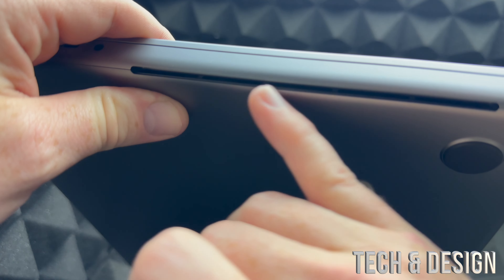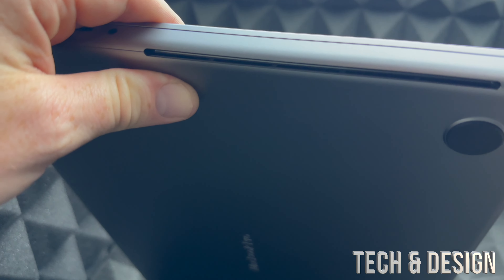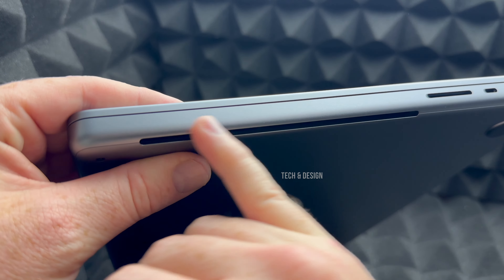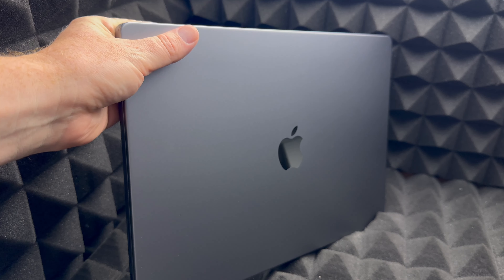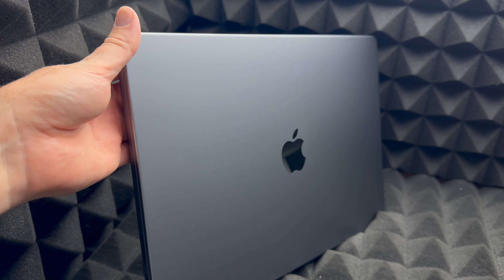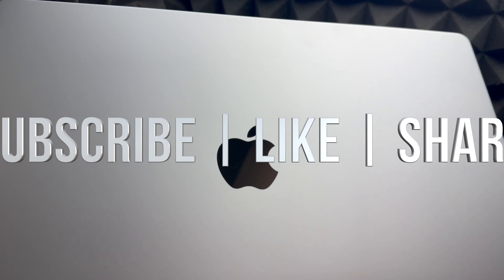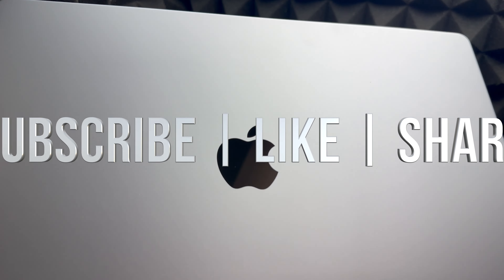To force shut down, just hold the Touch ID key until it turns off — there we go. Once it shuts down you can close the lid. I also want to show you the ventilation — see this right here, you've got the same thing on the other side, that's where it breathes. If you get a case, make sure it has these cutouts or it won't ventilate properly.